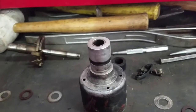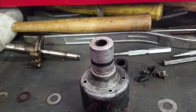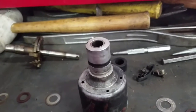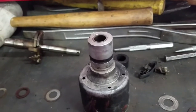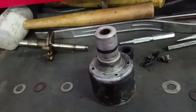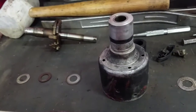You can buy recurve kits for HEI distributors. The problem with running a derby car with a vacuum advance is that the vacuum advance module gets in the way of a distributor protector, so you take it off — but then you lose some advance and it doesn't run as great. You'd have to run so much initial advance at idle, and I prefer to keep it lower for a smoother idle.